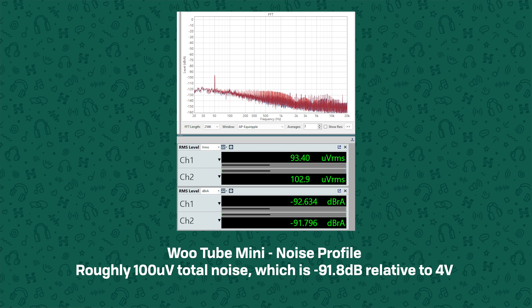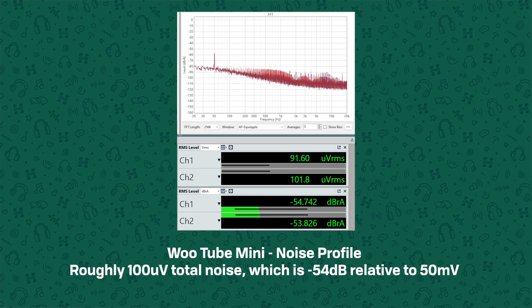When you're using this just as a portable DAC outputting to a separate amp, it's got about a 91 dB signal-to-noise ratio, which means you'll have almost 16 bits of noise-free range. Same goes if you are using over-ear headphones with it turned up most of the way. The only time it's really going to be a concern is if you are wanting to use IEMs. Outputting a 50 millivolt signal, more typical of what you'd put to sensitive IEMs, it's about a 50 dB signal-to-noise ratio, which is 30 dB less than a Chord Mojo 2. So with many IEMs, you may find that there is some level of audible hiss. I would not really recommend this if you are an IEM user, unless you have particularly difficult-to-drive IEMs. The output impedance is low though at 0.2 ohms, so you won't have to worry about it changing the frequency response of your headphones or IEMs.